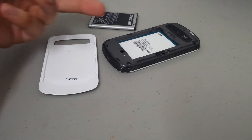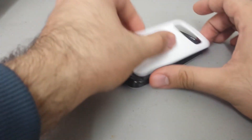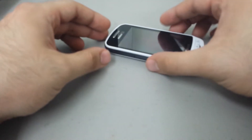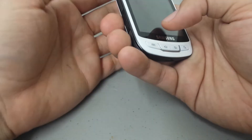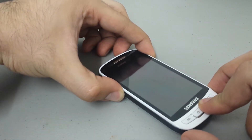I removed the battery and the back for about 10 seconds. Now I'm going to put it back together. Make sure you have at least 20% battery life, and look for your volume rocker — that's your volume up and down keys on the side. You've also got your back key on the front. What I want you to do is press and hold volume down, back, and then power all at the same time.